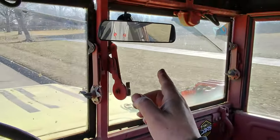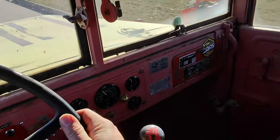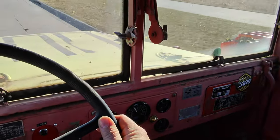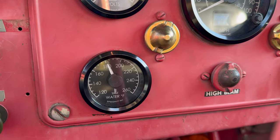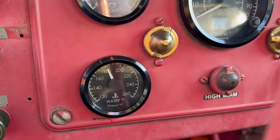I have the truck outside now and I did put some fuel in it — the gauge did go up so I think that's working. Water temp is coming up and the speedometer has satellites now. I did put on one of those suction cup rearview mirrors. Looks like we're doing 40 miles per hour — I think that's a good cruising speed in this truck. Now that everything's up to operating temperature, it looks like the water is about 180 degrees, which is right where it should be.